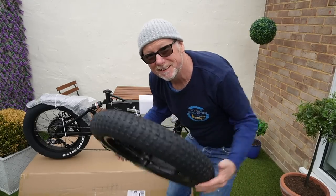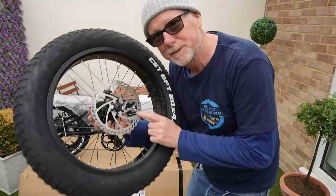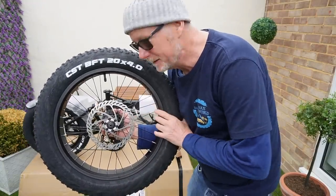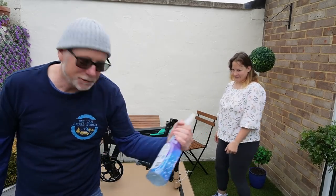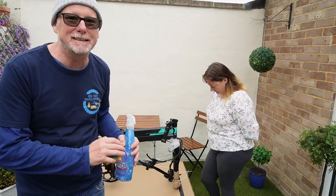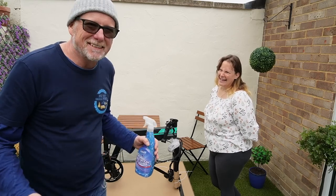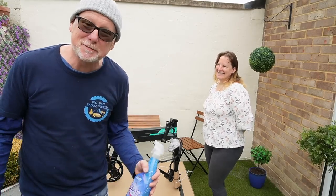Surprisingly light — I thought that was going to be a lot heavier than that. Look at the tread on them. Brilliant. Proper disc brakes. Now these do feel quite oily — they've got a film of oil on them, probably to protect them and stop them going rusty. It'd be a good idea to clean that off so it doesn't contaminate the brake pads. Use some brake cleaner or a strong detergent — bathroom cleaner is perfectly fine as long as it breaks down the oil. This is really important because once those brake pads become contaminated with oil, their integrity is definitely compromised — and I say this as an ex-car mechanic.